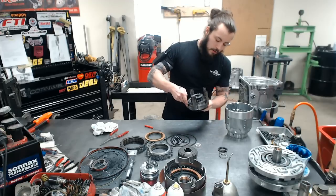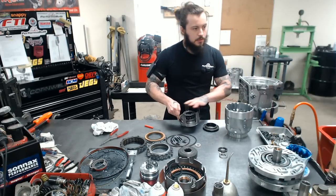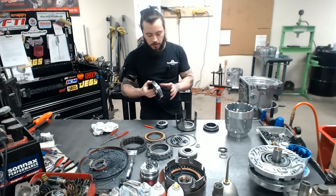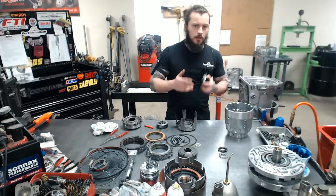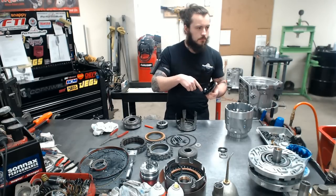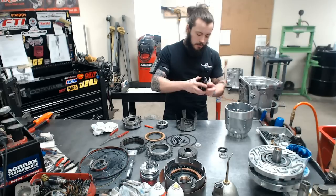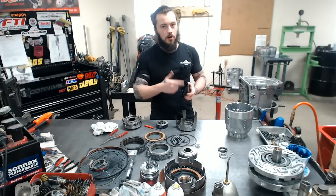Right now we have our first step, anyway, would be our piston set for the bottom section of the drum. And this is what applies all your clutches. We don't use any of the aluminum lip seal type pistons. They're total garbage, and we just throw them away. But what we do is use all molded pistons.